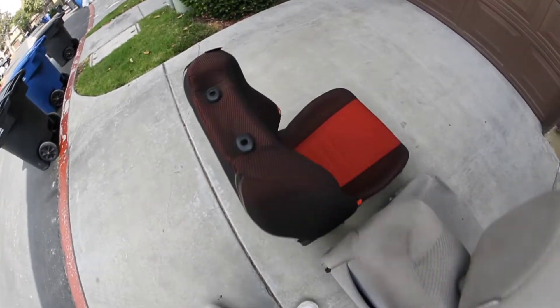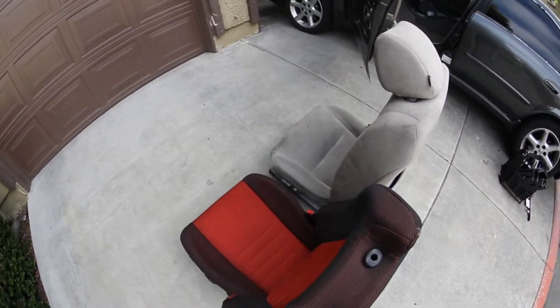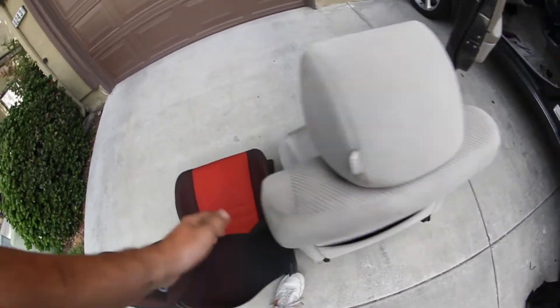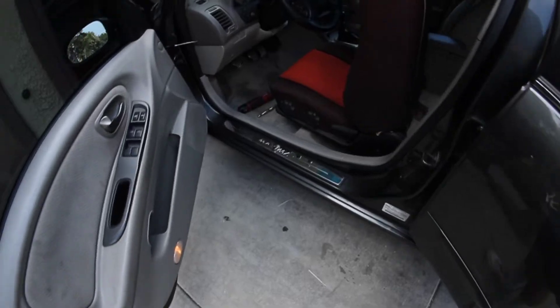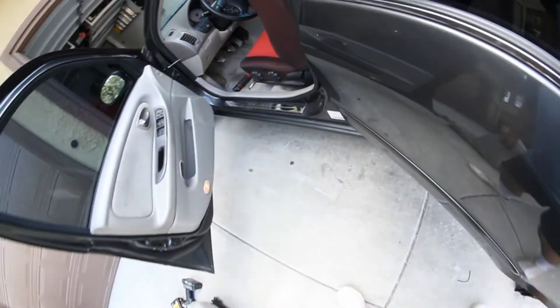To put it in, you have to drill out these stock bracket holes on the SER seats, so you will need to get the stock rails with these seats. They're always going to be manual — I don't think these came in electric rails. So that's the only thing you're going to lose on the SER seat swap: the electric rails. I'm going to show you guys where to drill right now. These two front holes will line up just fine — all you have to do is re-drill these rear holes.